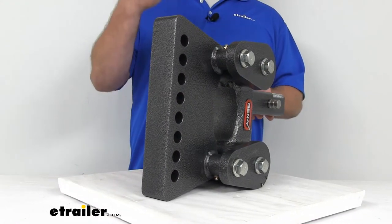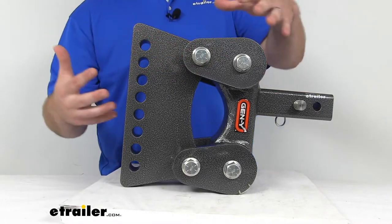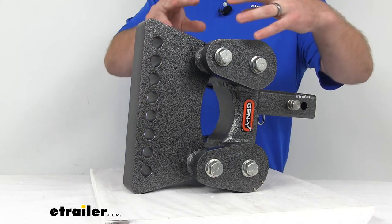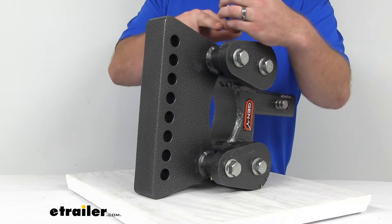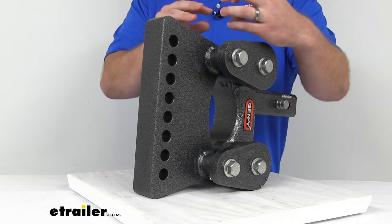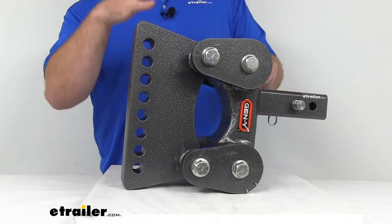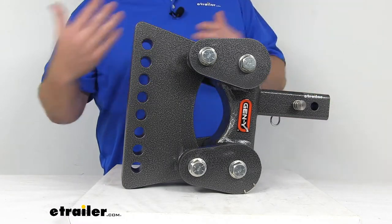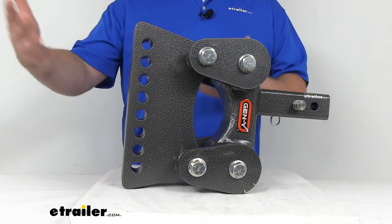The second main feature of this is the shock absorbing capability. You can see we've got these arms here — these are going to give us that torsion capability. If you're not familiar with torsion, like torsion axles, basically there is a square bar inside of the tubes here and there are rubber cords on the inside. As you experience shock and jolts, that bar is going to twist, but because those rubber cords are in there, that's going to provide the resistance to make that less jolting and much more smooth. It's not going to allow that shock and jolt to be transferred from your trailer up to your vehicle or vice versa, so it's going to be a much more comfortable ride for you and much smoother for anything you have in your trailer.